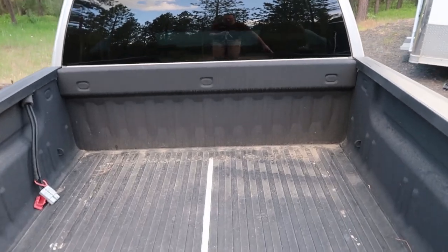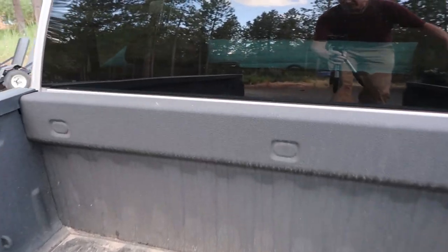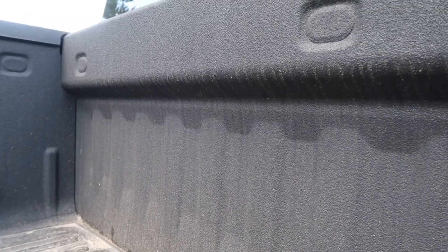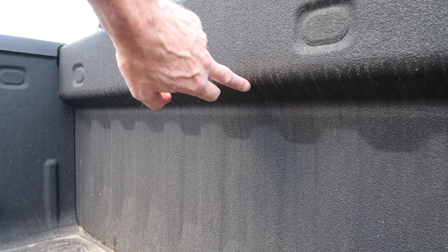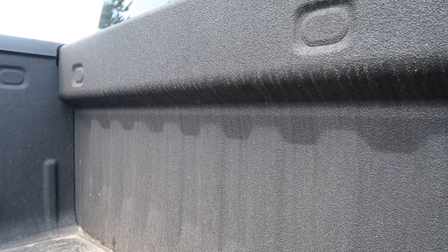The other reason is because these bumpers are just a little bit too high for the design of the front wall on my truck bed. Looking at the truck bed, you can see how the sheet metal has a contour in it. Those bumpers hit right in the middle of this bend — the top of the bumpers do. So that spacer gets the front of the truck camper and those bumpers off the front of the truck bed.